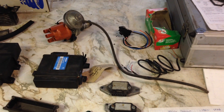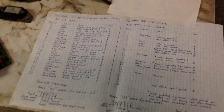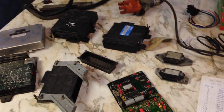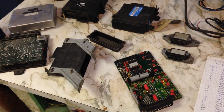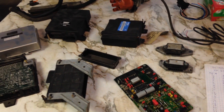Just shoot me a message and I'll attempt to answer any questions — jog my memory. I did this conversion about four years ago and haven't had a problem since. The LH 2.2 pinouts are available all over the place, and there are wiring diagrams and wiring manuals out for the Saab 900. Of course, this will work on a 9000 as well — if you have the 9000 2-liter from 86 to 89 or 90, that would also be a good performance benefit for that engine. Since basically everything is identical between the two cars, just with different engine configurations, you'll get the same benefit in the 9000 as I did in the 900.